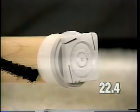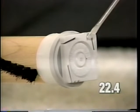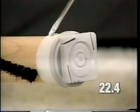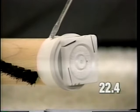Also make sure the end caps are on the correct end of the brush roll. The small end cap goes on the magnet ring end of the brush roll. If the caps are on the wrong end, the magnet will be at the wrong side of the nozzle and will not light the BPI light.